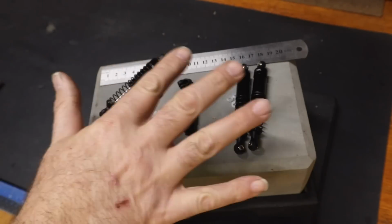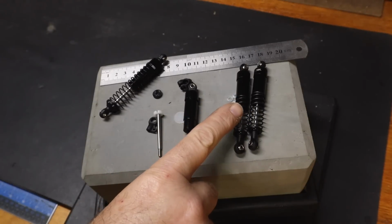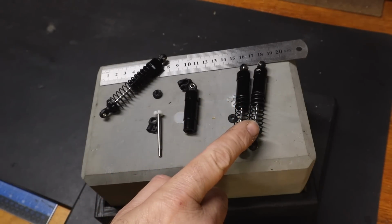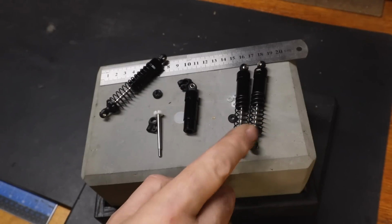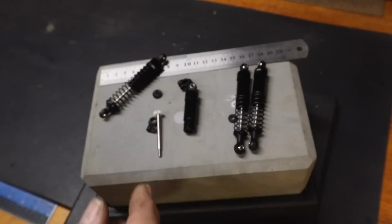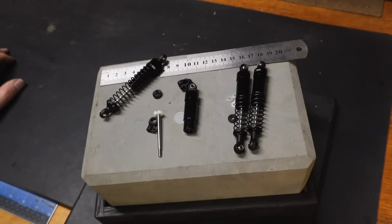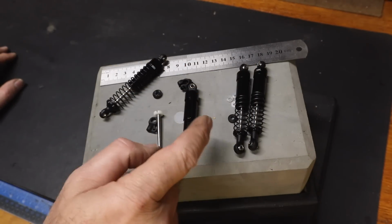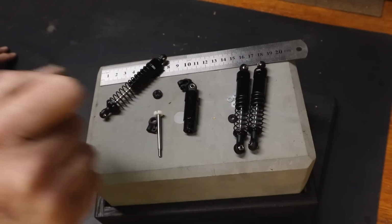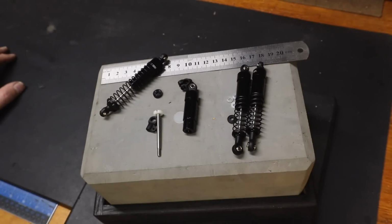So what you have is a shock that is well built and it is functional, but it is unusable because of how heavily it's sprung, and there's nothing we can do about it. And I go back and forth. On the one hand, I don't want to have to fill a shock with diff oil. On the other hand, that shock is going to leak out very, very slowly. And the seals honestly feel pretty good, especially if we're showing that amount of growth.